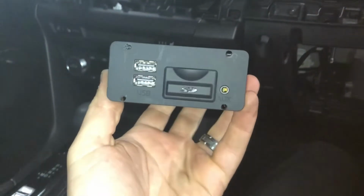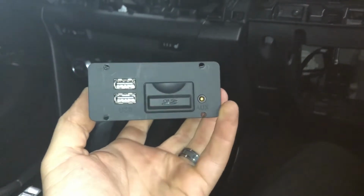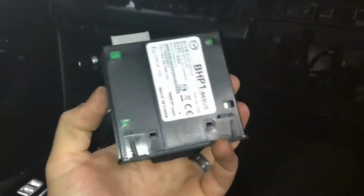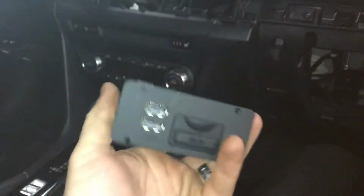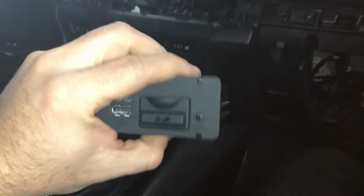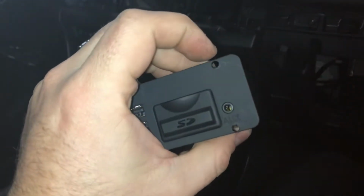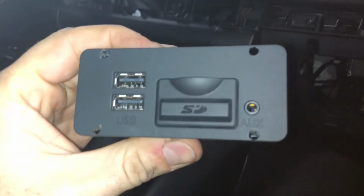So I took my time, I took my 1/8 inch drill bit, I drilled the 4 holes, and every time I did, I heard the little click or pop of the plastic tab. This one actually kind of hung on. You can see where the drill bit went through it there. But the other ones here, you can see they're gone. I mean, they're just absolutely gone. So you'll want to be careful though. You can see that even on the one that I drilled out here, I was careful to not actually drill into a part of the car that's going to be staying here. I did leave that little bit to allow me to not scratch up the car.